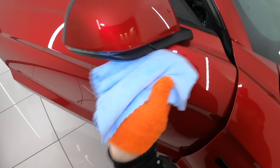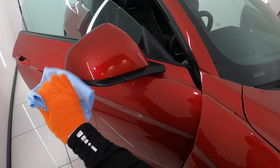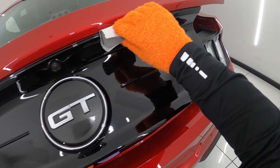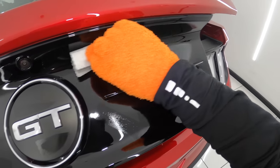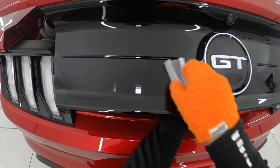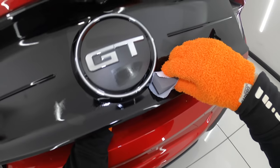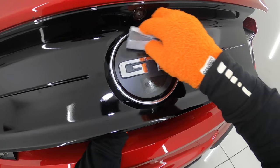Your second cloth is for buffing the section streak-free, and you should wipe well beyond your section with this second cloth to help blend the coating in and avoid any patchy finishes, as well as address any potential high spots or streaks. And as a whole, I'll tend to use about 6 microfiber cloths in total to coat an average car, flipping the cloths over to a clean section after every few sections and switching to clean cloths after every few panels.